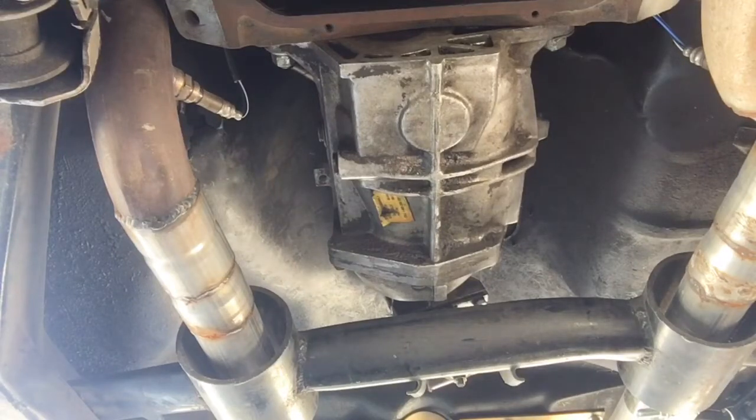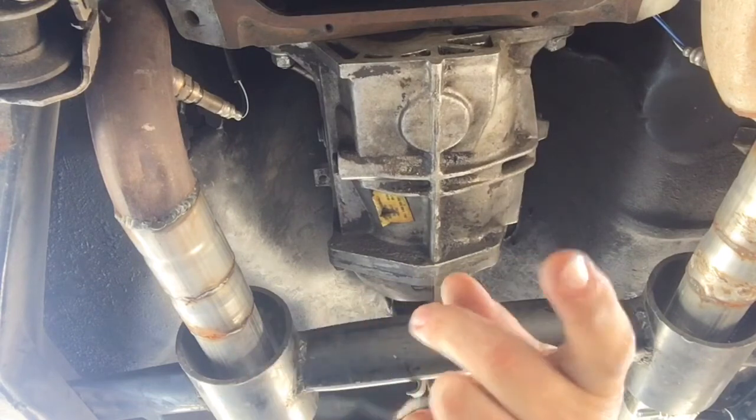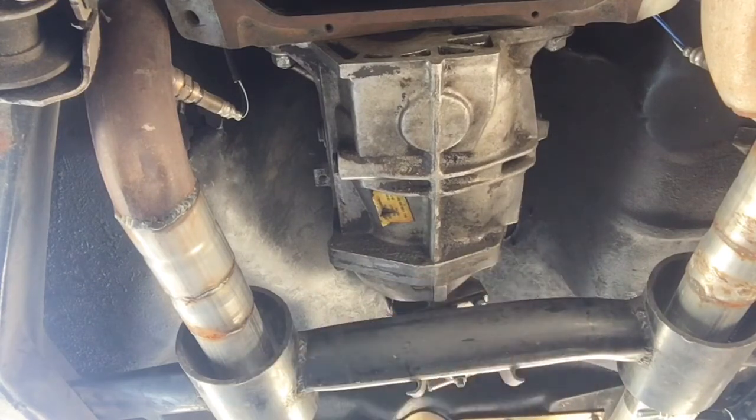We're eliminating the possibility of it echoing or transferring through the driveshaft up into the transmission case. We pulled the driveshaft out of the back of the T5 and drained the fluid out of the T5 — it still has some in it, it's not completely dry. Until I can separate the tube between the transmission and the rear end, the problem has to be between the output shaft of the tranny and the pilot bushing in the crank.